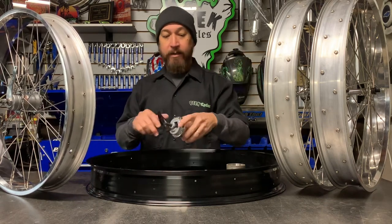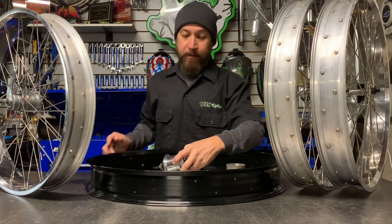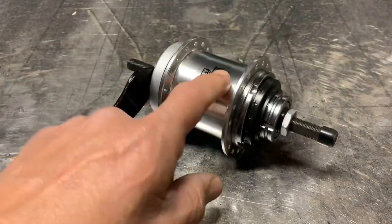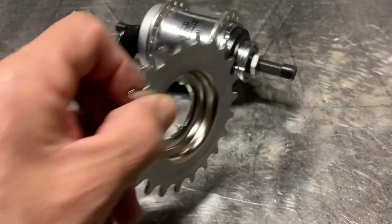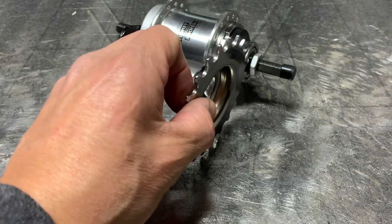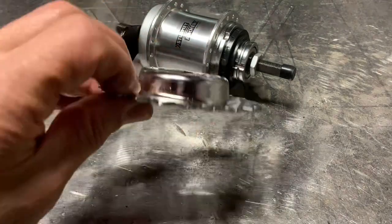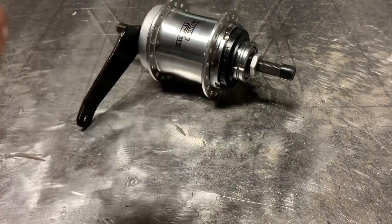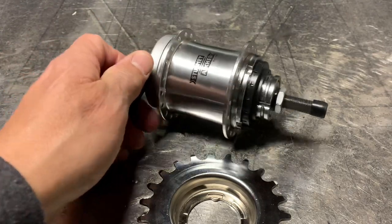As for hubs, I'm going to show you a close-up of the Nexus 3, which is very commonly used, and the Sturmey Archer SRC3. This hub will be used for 3-inch or 4-inch wide wheels. However, I'm told that for 4-inch wide wheels it is unsafe to use offset cogs on this hub — you can use them all day long on the Nexus 3. From my understanding, the torque and tension from these cogs can ruin the internals of the hub. Now, I've been using these on Sturmey Archers even on the wide hubs with no issues, so if you do it, that's on you. The reason I like these hubs is because they're beautiful — nice big wide flange, you can drill them out for thicker gauge spokes and have them polished out to chrome.